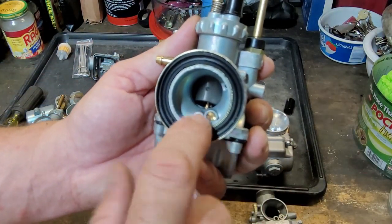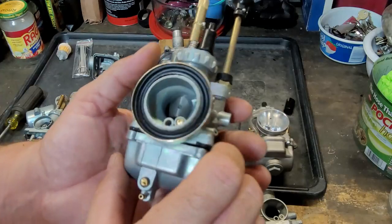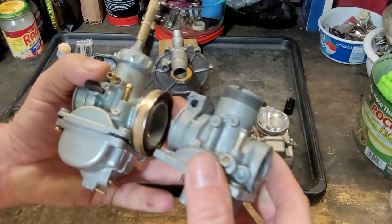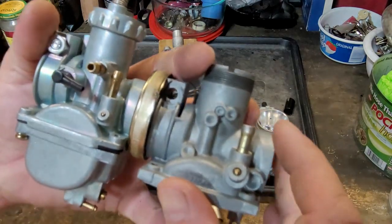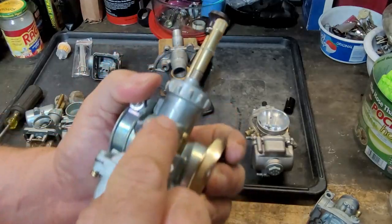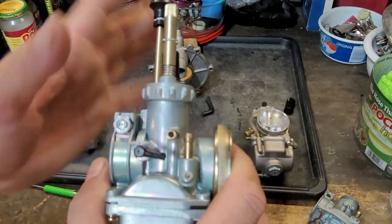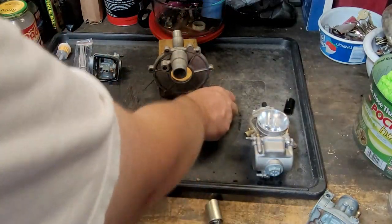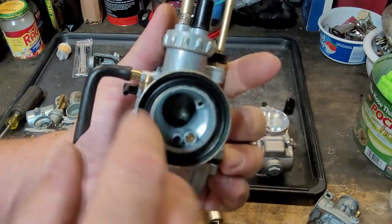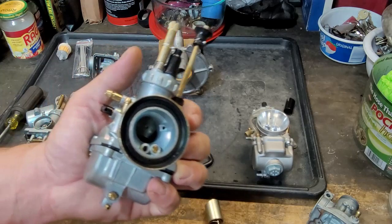This one has the adjustment in the front — it doesn't really matter if it's on the front or on the side. Now we flip it over to the side and we have three ports. On our Kawasaki KE-100s we only have one port for fuel, which is this one right here. This one is a vent — this gets vented to the atmosphere. You don't need to cap it, you don't need to do anything with it, just leave it alone. Some carburetors even come with a down tube on there, but honestly you don't need it.